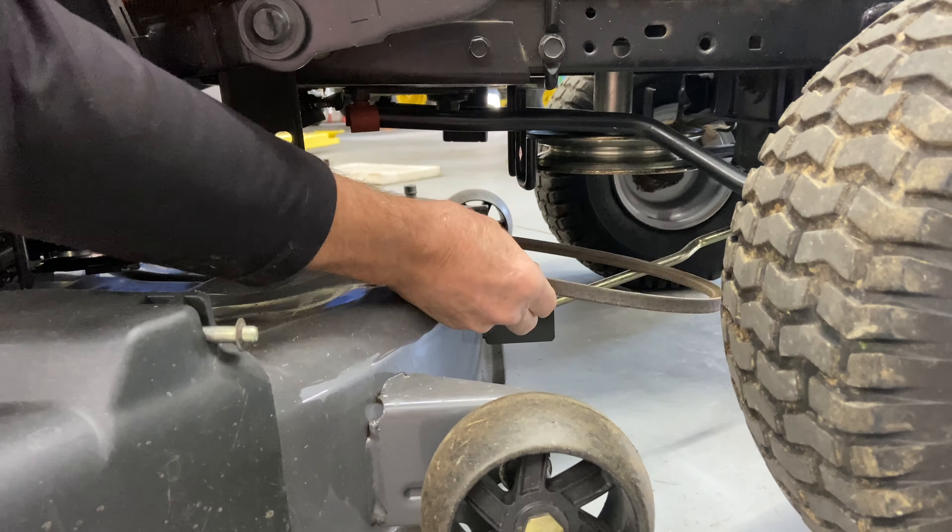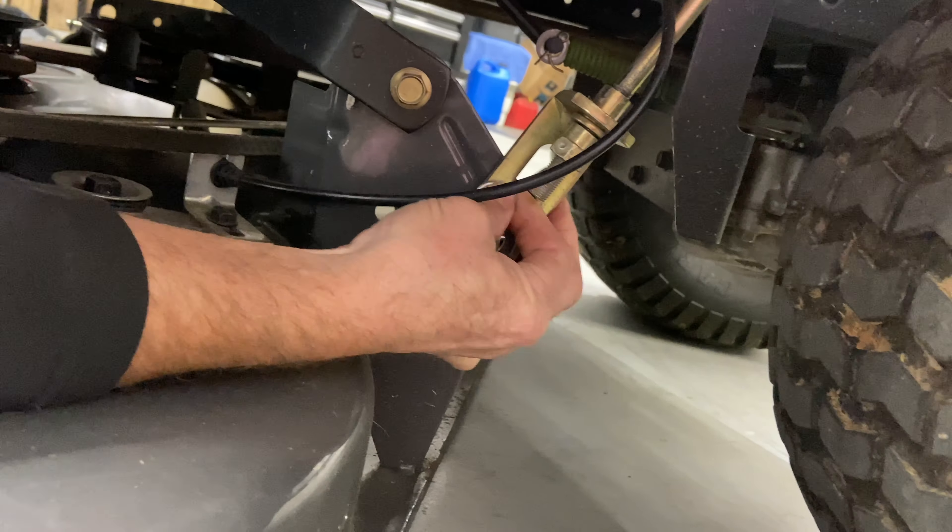Going to the other side — take this clip off; it has a washer and a little tension on it. I put the pry bar underneath the back of the mower deck, and just sliding it in and picking the deck up a little let it fall right off. Then we have our middle clip. I always recommend having the clips facing rearward when you put them in — if they face forward and hit something they could pop out, but facing rearward they'll stay locked in.